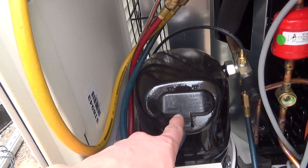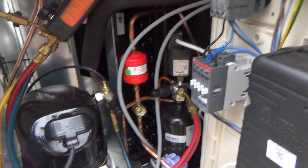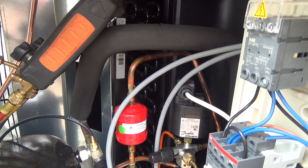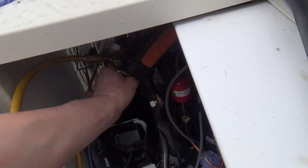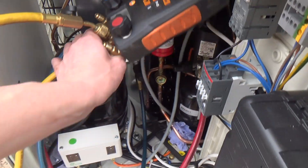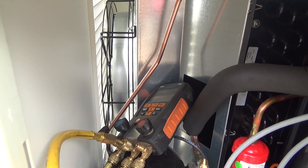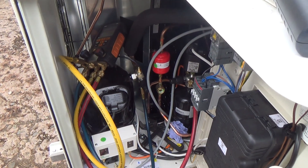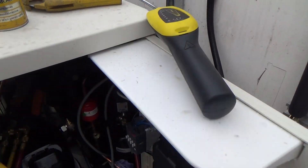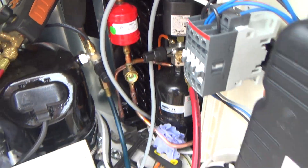It's a nice little unit — they can really fit a dryer, sight glass, contactor, and pressure switch in there. I've put the fan speed control on there. Had it on pressure test for a bit — it lost 1.7 psi but that was before I put the magnet on the solenoid. Since then it's been two hours ten minutes and not a drop. We've been around it with a leak detector and put trace gas in, checked all the braze joints and all these connections — just about to get the vac pump going.